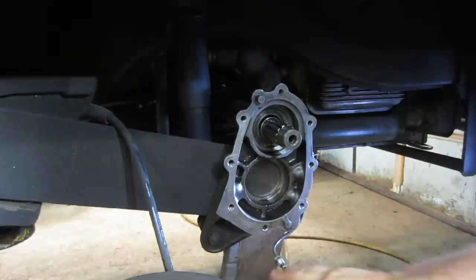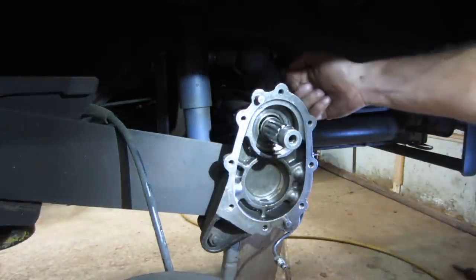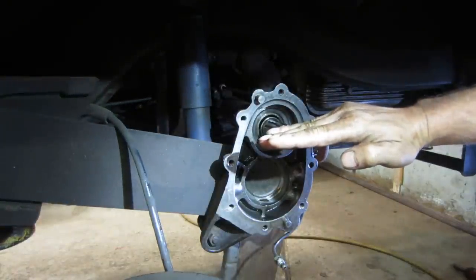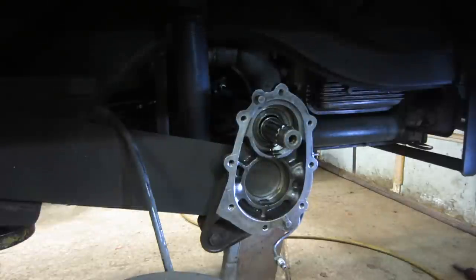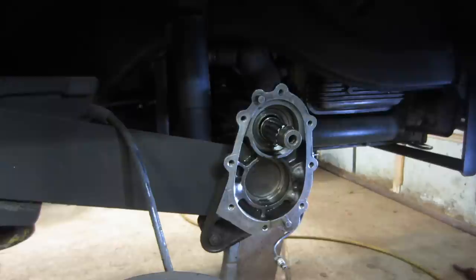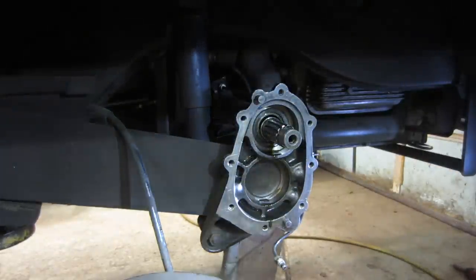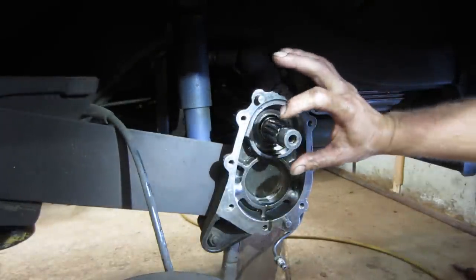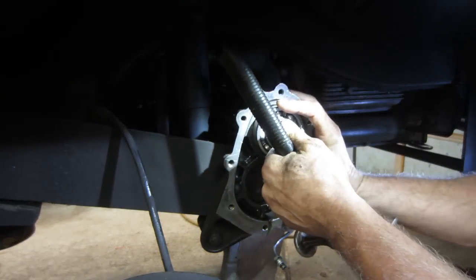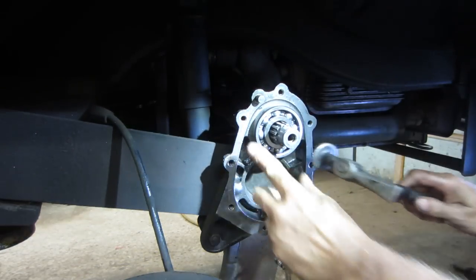And I put a floor jack underneath it with a board. You see the board down here. Just so the axle is straight, because the gear oil wants to come down the axle tube and maintain a fluid level of about that high inside there. And of course, when I did my little maintenance on this truck the day before yesterday, I topped that off. So everything wants to come right back out this tube, and that's going to fight us a little bit for filling it. So hopefully I can get this bearing back on. I don't think there's anything that should be stopping us from this one. And possibly that might even help hold some of the fluid in. Tappy tappy.